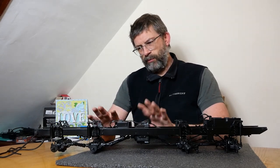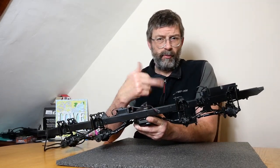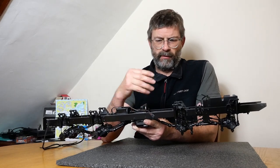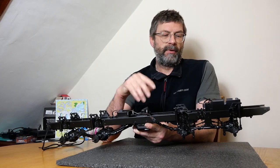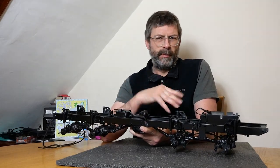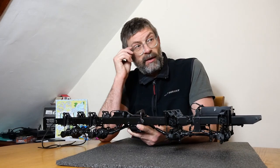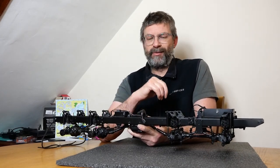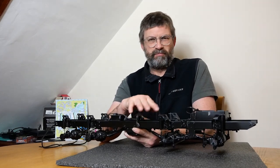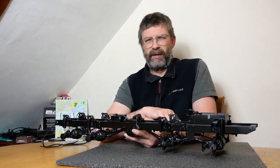The other important thing I want to show you — I am putting the revolver motor back in. It started life with the noisy outrunner rotating revolver motor from Holmes Hobbies. I took it out and put the BC8 sealed can brushed motor in, and I think it lost a little bit of character. It's a good motor, nothing wrong with it, just very quiet. I've been watching some of the old videos with Terry, and we miss the noise it used to make. So the revolver's going back in — it's brushless but unsensored, so there's even a little bit of cogging at low speed, which I think is quite fitting. These trucks are clunky in real life, they're not the smoothest things in the world.